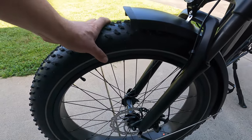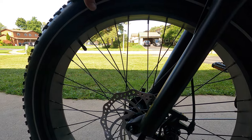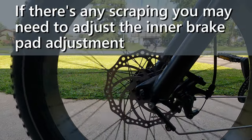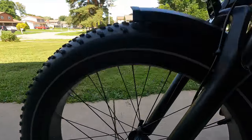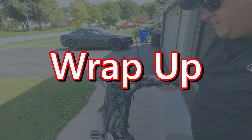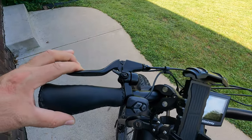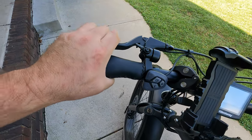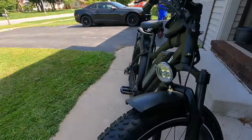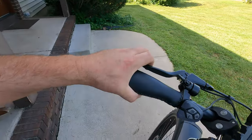Now that the brakes are tightened down and the caliper should be lined up to the brake pads, I'll go ahead and release the brake. Now that the adjustments have been made, we're going to make sure that our tire is not scraping anywhere, so we'll pick it up and spin it. No scraping — that's perfect! It's as simple as that. Now you can see that our brake tightens up right about here and no longer touches the hand grip — there's some nice tension there.